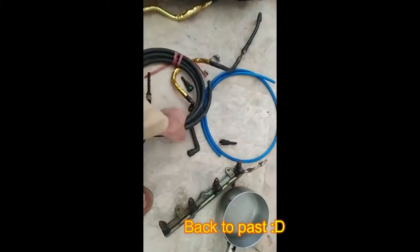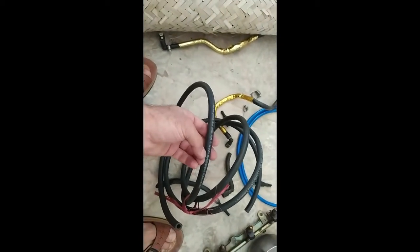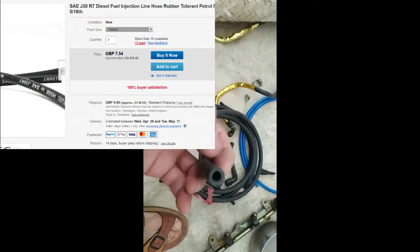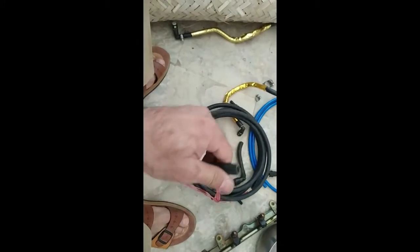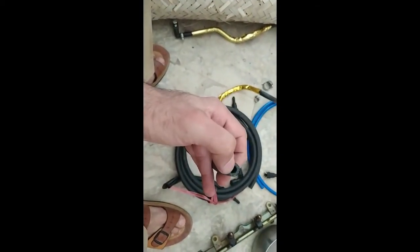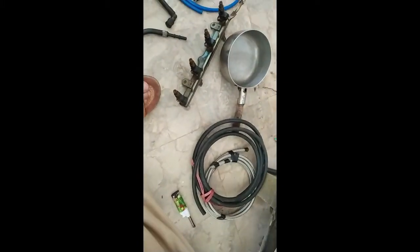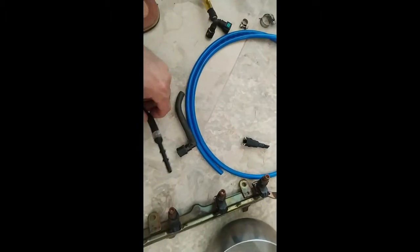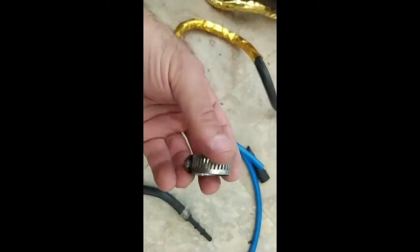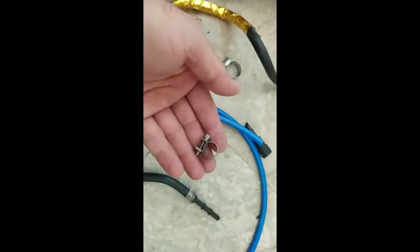The third option is rubber pipe. Always use a good brand — Goodyear, Parker, etc. — and it must meet the SAE J30 R7 standard, otherwise normal rubber pipe will melt or leak fuel over time and deteriorate inside without showing on the outside. The fuel eats away the inner lining. Isolate the pipe and on the ends use fuel injection clamps — not conventional hose clamps. Order sizes 9–11mm and 11–13mm; they are very cheap so having all the range is good. Also sleeve rubber pipes with a Vulcan sleeve.